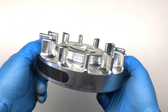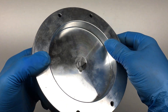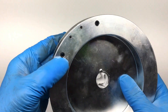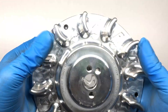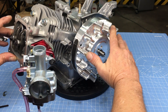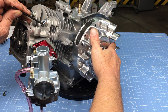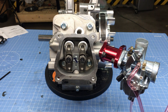Fortunately there's a flywheel better suited for higher RPMs: the ARC billet flywheel with an integral cooling fan. Everything about this flywheel is on point — all the corners are radiused to prevent stress risers and the magnets are pinned to prevent catastrophic damage. This gem weighs in at 3 pounds 7 ounces, quite a bit less than the stock cast iron flywheel. ARC is not a sponsor of this channel, but I like to say good things about them because they build outstanding products. We did use the ARC flywheel when we built the 212cc engine that got us to 54 miles per hour in Season 1. The problem is these flywheels are for high-revving engines, not engines under constant load for extended periods. They're intended for lightweight go-karts or minibikes, and for our application they don't provide enough cooling — we'll demonstrate that later in the video.